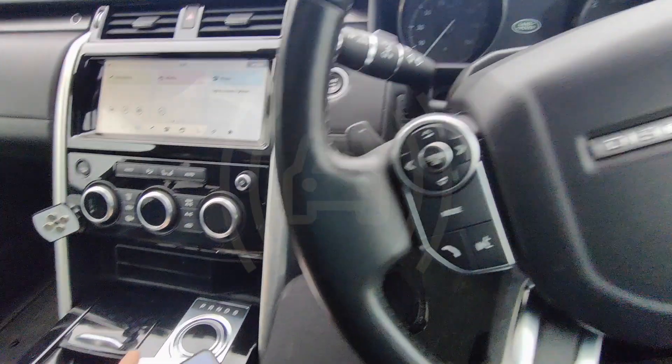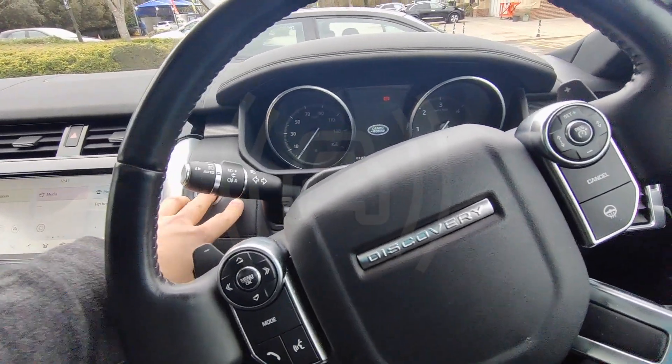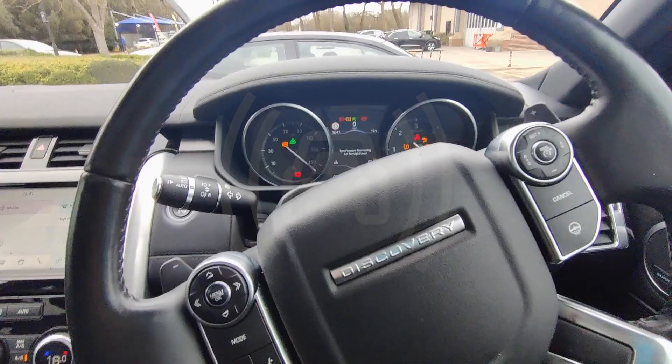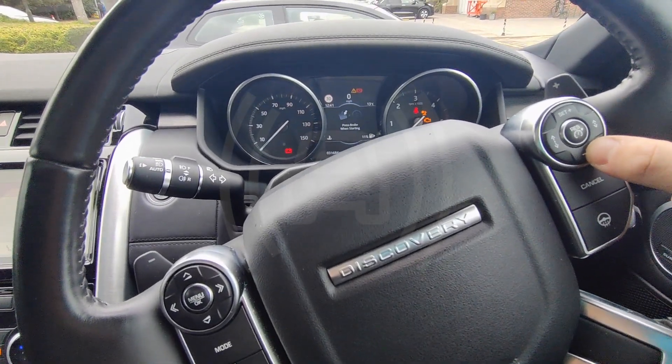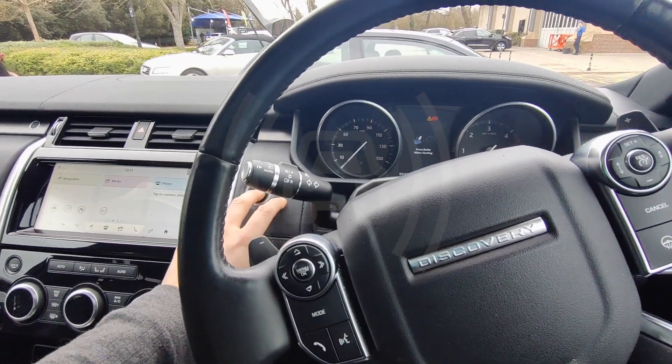The vehicle's secure. If you ever wanted to change the code, you do this: first disarm the system, press any button five times — one, two, three, four, five — turn the ignition off and back on again. You get five bleeps.